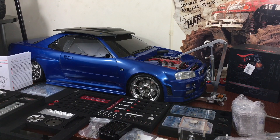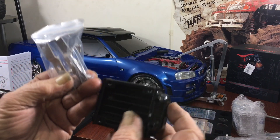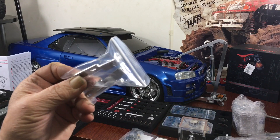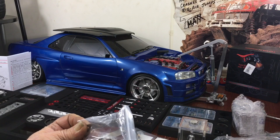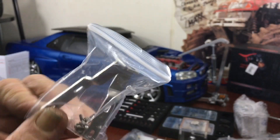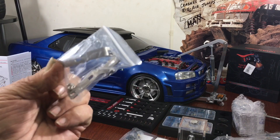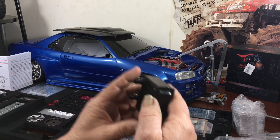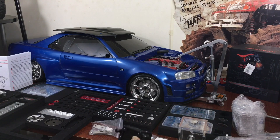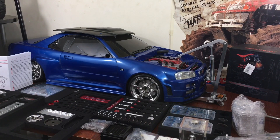I bought the radiator with the brackets and I strongly suggest you buy the ones with brackets — they're a couple of bucks more, but they bolt right to the radiator and come with all the hardware you need. You can alter them for your build. On mine I custom-made brackets to mount the radiator sideways and as close to the fan as possible to pull air through, but it took about an hour to make two simple brackets.